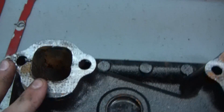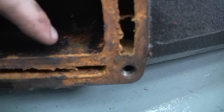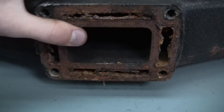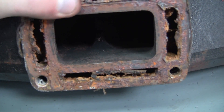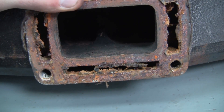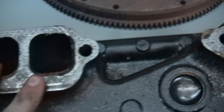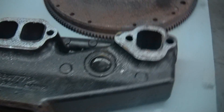Here's your old manifolds — very, very worn, water in every cylinder. It looks like there may have been a riser gasket possibly leaking right here. You can see where the rust trail is all the way down into the manifold. Very common for Volvo riser gaskets, just because they've got a real thin wall between the water jacket and the exhaust port, so there's not a whole lot of gasket material between there. This manifold doesn't look terrible, but just to be consistent we changed both sides.